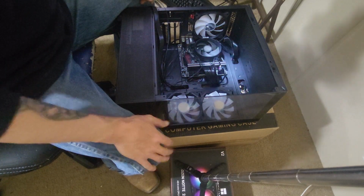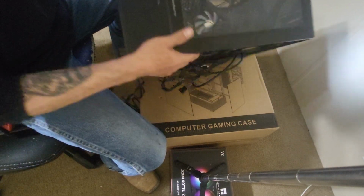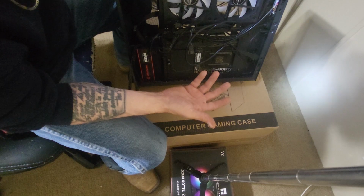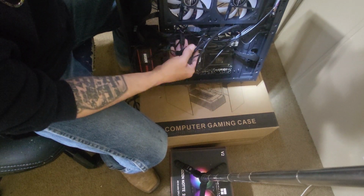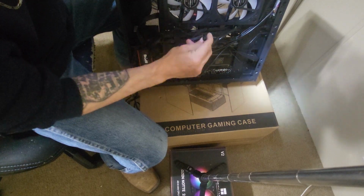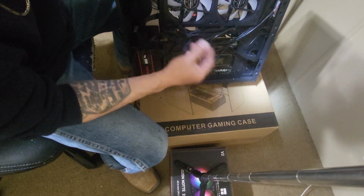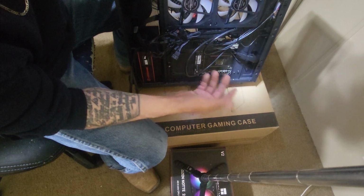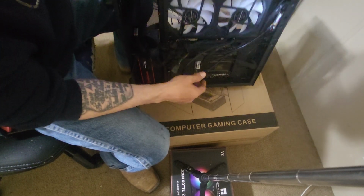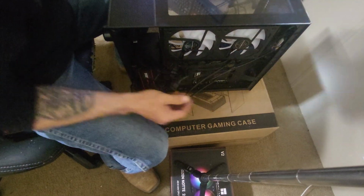The other thing that I've realized, and I might have to figure it out as I'm finishing up with this build, is I don't see anywhere for the fans to get power. So I'm going to have to see when I go to turn this on if the case fans even spin up, because I've checked through here. There's no SATA connection, there's no Molex connector, basically there's no connector on here. There's this 4-pin here, but this is just to daisy chain your lights together. I may have to find a way to get power to these fans, but that's something I'll check out when I go to boot it up and see if the case fans even spin, because as of right now, I don't know exactly how they're going to get power, and I don't know if I'm going to be able to change the colors of the lights, and that's going to be kind of bunzo McGee.